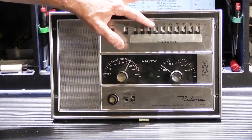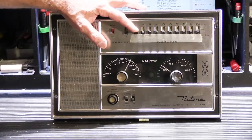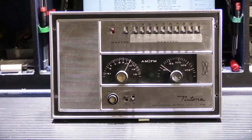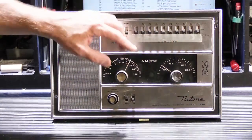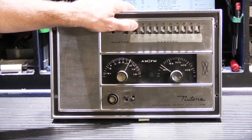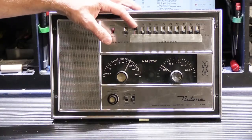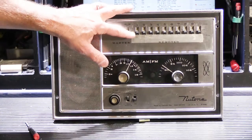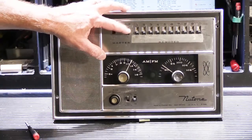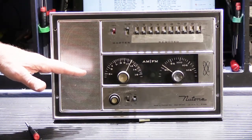We have our 10-room control switches, so you can have up to 10 remote speakers — a combination of inside remotes, door speaker remotes, and patio speaker remotes. On the room control switches, the bottom setting is both radio and intercom, the center setting is off, and the top setting is listen, which is like monitor or listen-in on modern systems. Up here it says volume: low, off, or high. This is your master speaker volume — set it to high, it plays at the highest volume; set to low, it plays about a third less.